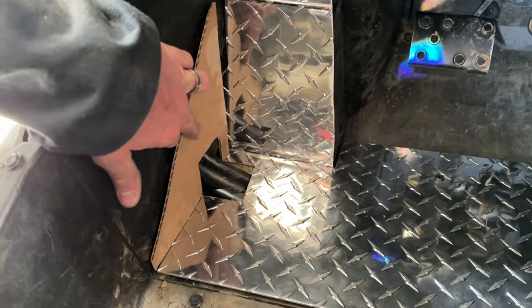After sanding down both sides with a flap disc, I took a Brillo soap pad with some water and scrubbed it down front and back to remove any contaminants or sanding debris. I let the part dry completely, then started adding a couple coats of Rust-Oleum two-times-coverage paint primer gloss black automotive grade — coated the front and the back. Now we're just letting it dry, and once it's completely dry we'll mount it in the machine.